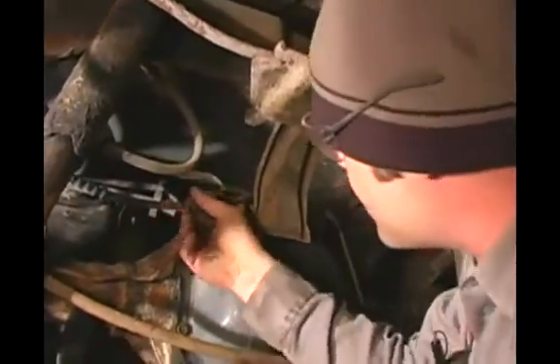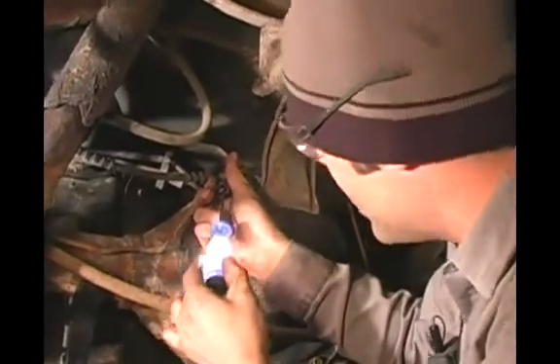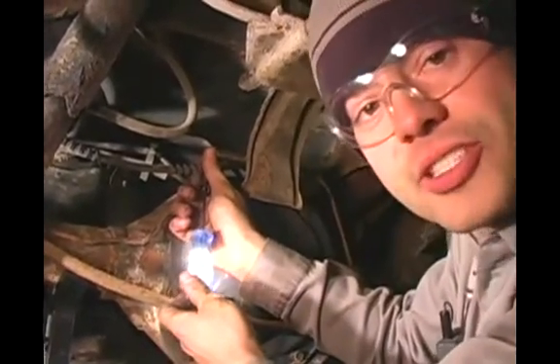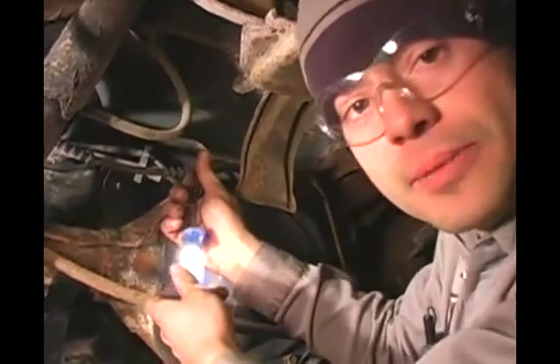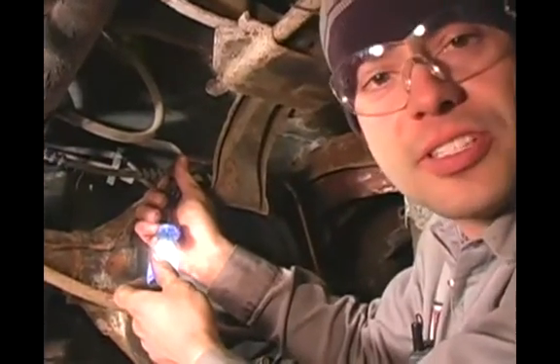It's right under here. I'll switch my connector and grab a hold to test the other side of the circuit. As you can see, the light lights up, which indicates that the negative side of the circuit is good. That narrows the system down to it being a failure with the sensor.